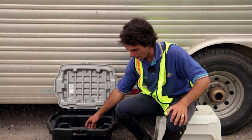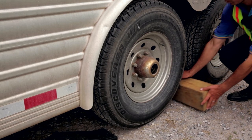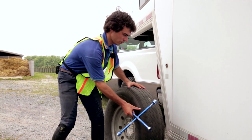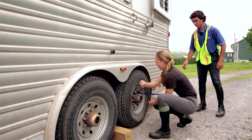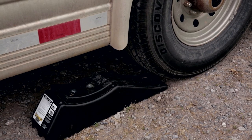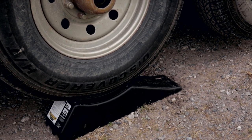That's about all our most important stuff. Let's get started on changing this tire. Step 1: Put the truck in park, apply the parking brake, chock the wheels, and position the ramp. Step 2: Remove the spare tire — normally there's only one nut fastening it to the front of the trailer. Step 3: Loosen the nuts. If you're really struggling to get them undone, try applying some WD-40. If not, find someone stronger. Step 4: Try not to hurt yourself and swear. Step 5: Remove the chocks, drive or reverse onto the ramp jack, and once there don't forget to put the truck back in park and reapply the chocks.